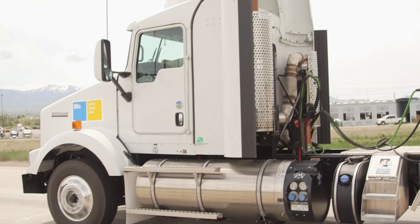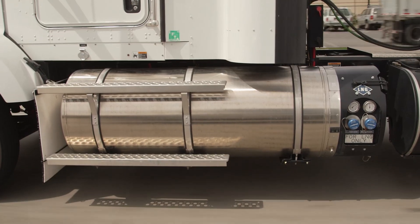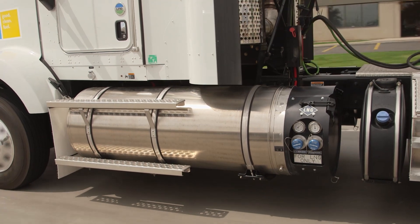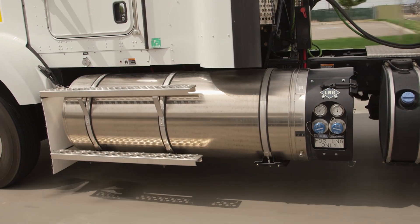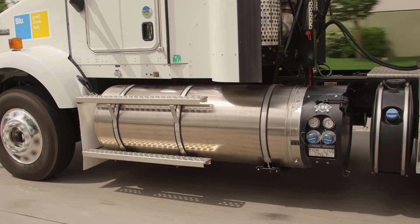This video describes a process for fueling vehicles with active LNG tanks. They're called active tanks because of the pump inside the tank that feeds fuel to the engine. These tanks do not have an external venting port, and the driver's side tank usually has two side-by-side fueling ports and fuel tank pressure gauges.